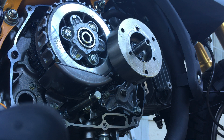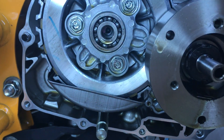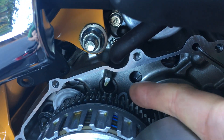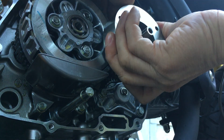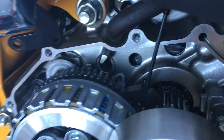Another thing you could do — and what I got — is this steel thing from V-Bike. It sits into this gear here. You see the drive gear and driven gear over here — it sits into this gear and wedges those two together, so that way it doesn't spin. So the two gears are locked together and it doesn't spin on you. You could do it that way as well — more than one way to skin a cat.